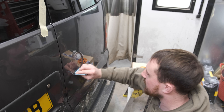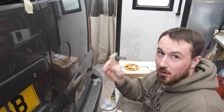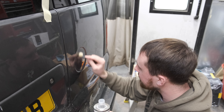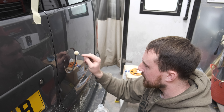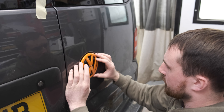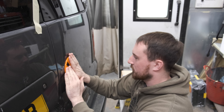Going back on with the badge — just cleaning it up with a bit of solvent degreaser first, then applying some primer-adhesion promoter for the tape to stick on. Leave that for a minute. We've got double-sided tape and a frosted wire on the back of the badge, and now we're going on with the badge. Using a careful eye to make sure it's straight — that's almost right.